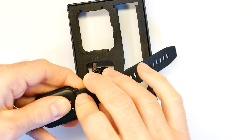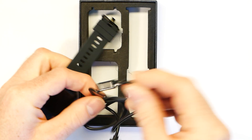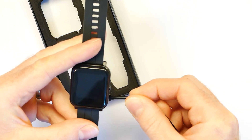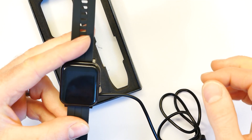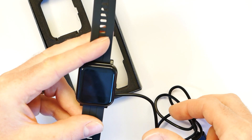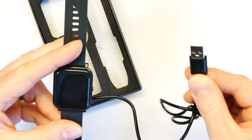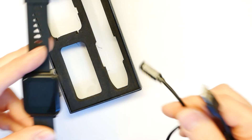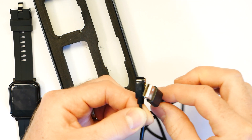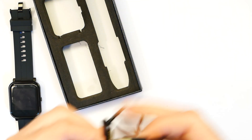When you get your Bangle it may be out of charge, in which case you're going to want to attach the charge cable. This goes in from the right hand side and just clips on like this. When charging is finished, which probably takes about two hours, you want to disconnect the USB cable from any power source. While there is short circuit protection in these cables, it's just better not to rely on it because they can attach to other metallic things that might be on your surface.